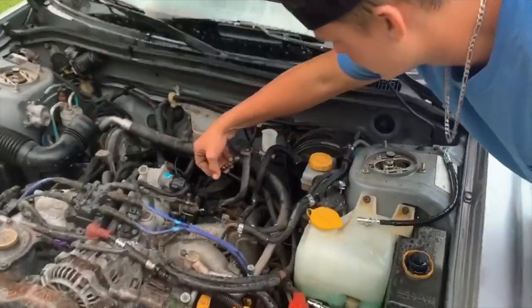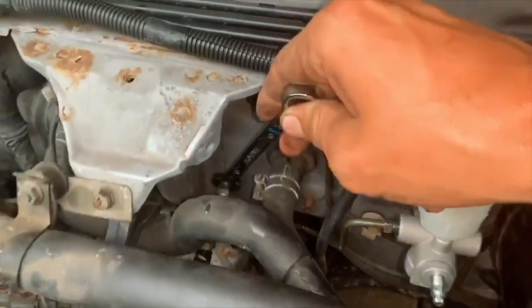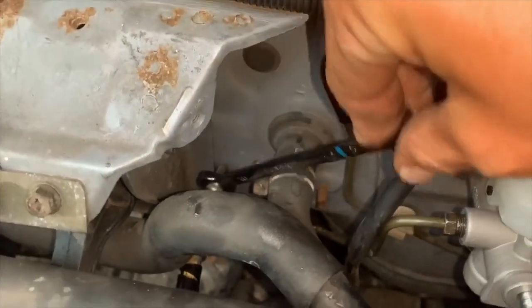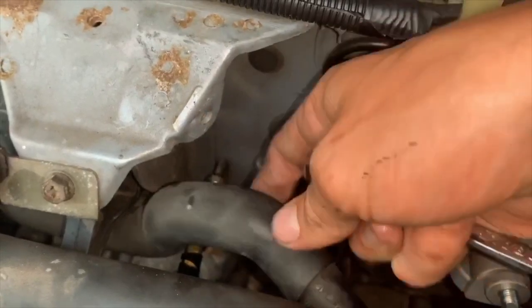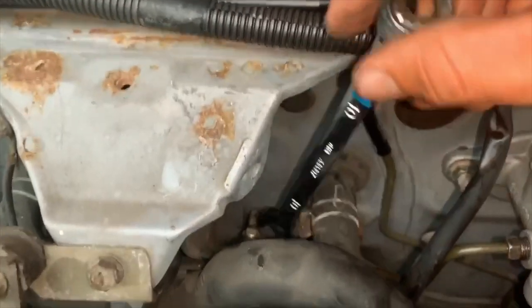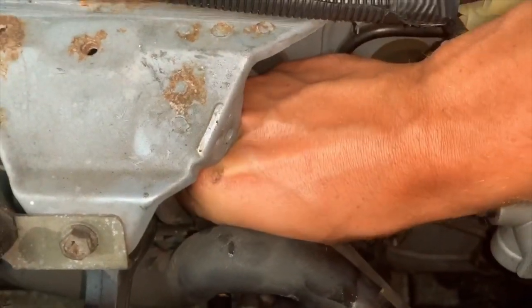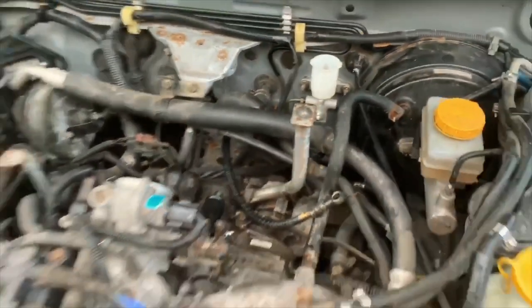This is the cable that was leaking. I tried using a brake line wrench but it's so tight in there. I ended up taking off the bracket which just holds up this line - that helped. It was kind of a pain but I finally got it - just little turns until you can get it off with your hand. If you have to replace that line, it's a pain to get to. Take off that bracket and other than that it just unscrews. I'll screw in the new one, attach it back to the slave, and bleed it from there.